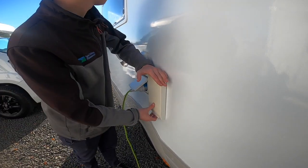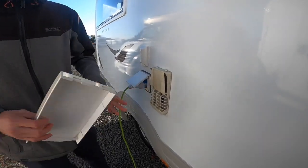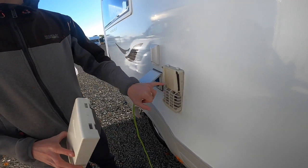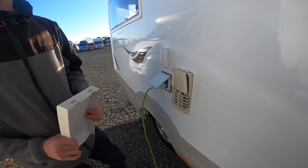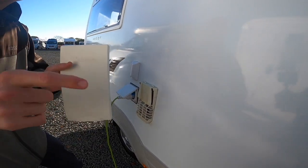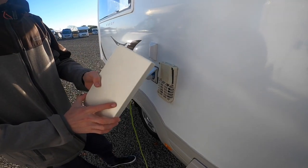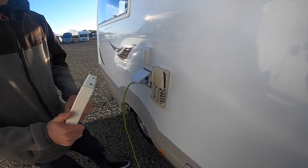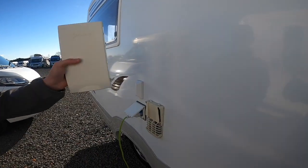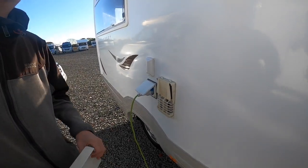To take it off, hand on the top, pinch in the middle and pull it off the vehicle. If it wasn't taken off when heating the water on gas, the fumes would circulate in here, it will fail and it will not heat your water. So the cover must come off and the best place to put it is in the passenger door pocket. When you're travelling and washing the vehicle, put the cover on as you don't want dirt to get in beside the grill.